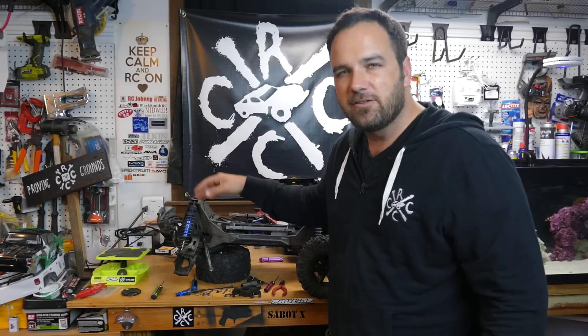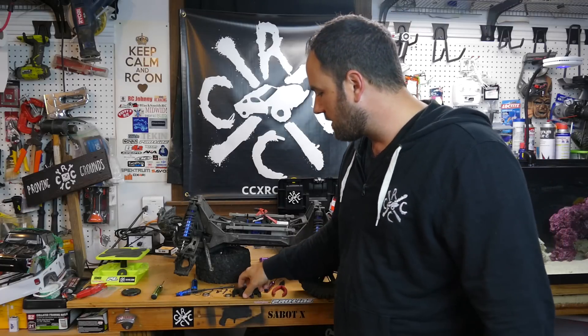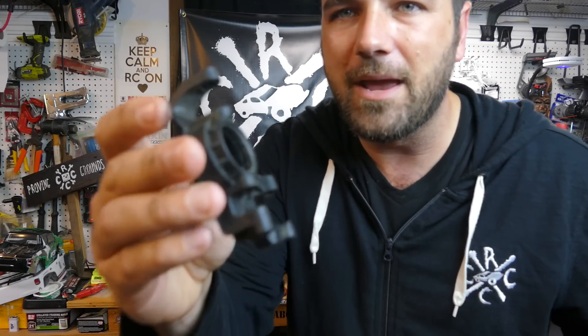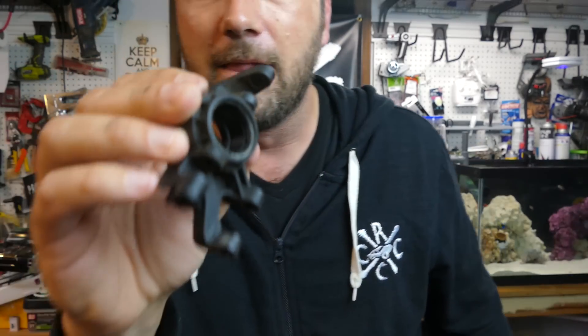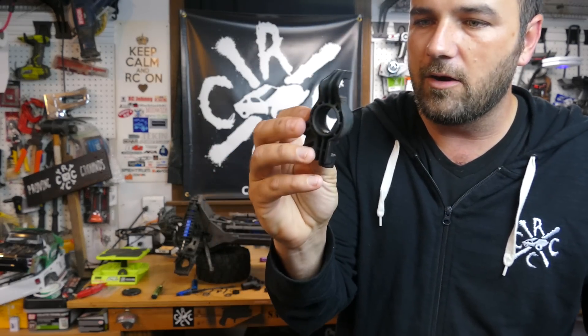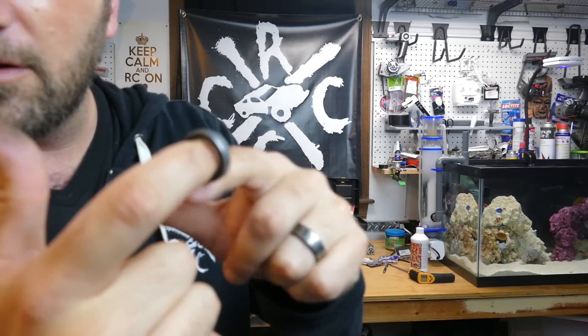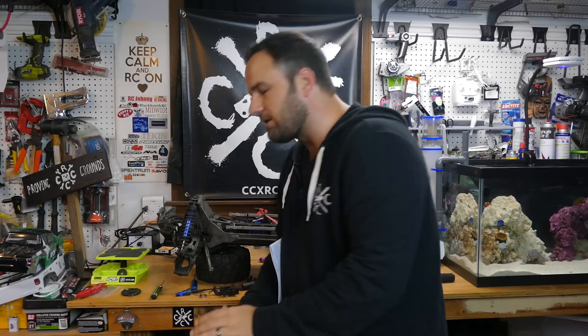Thanks for stopping by guys — I love it when problems are easy to solve. I actually picked up a new carrier, but I don't think there's anything wrong with this one other than the bearing pieces still wedged in here. I've got to pull that little ring out, but the carrier itself looks intact. This one is still spinning pretty smoothly, so I'll clean it out, lube it up with a little marine grease, and stick it all back in. Should have it up and running this weekend. Check you later, have fun RCing, and have a happy Fourth of July!